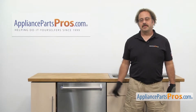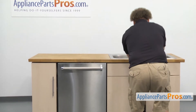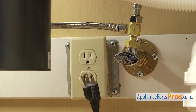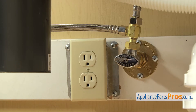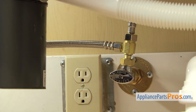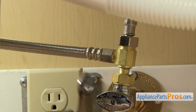In order to change the drain pump, we have to pull the dishwasher out of the cabinet. First thing we're going to do is go underneath the sink and disconnect the lines. Now that we're underneath the cabinets, make sure the dishwasher is still unplugged and you may want to throw a towel down. When we take off the fill line and the drain hose, there's going to be some water that comes out. First, we're going to disconnect the fill line — it's connected right here to the hot water valve. Make sure the water valve is off, then use our 5/8 inch wrench to loosen up the hose.